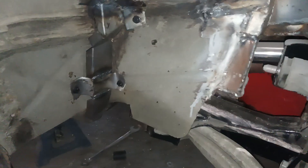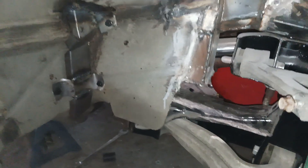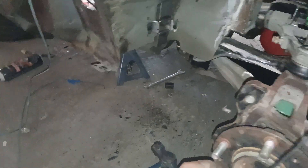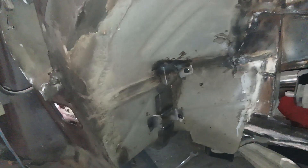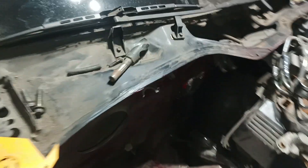We did some work on fuel line stuff. As you can see, I got a little piece of sharply cut metal in this corner — that's literally a splash guard, a hit guard, to stop the wheels at full turn from bashing into there. We're gonna run the fuel lines inside there. This runs a wheel spacer with about three inches of backspacing, so the only bit that might worry me is this corner right there, but we can always bash that in or keep the lines to the inside. We can cut and smooth it over, and looking at the radius it does kind of miss that. The main reason for it is so we can run our fuel lines up through here.